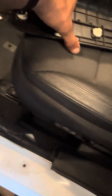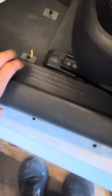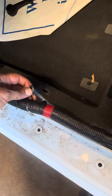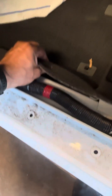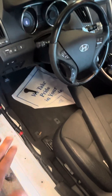To get to that, you take a tool like a plastic crevice tool and you pop this out. That will pop out and then you have to remove this zip tie to get the wiring harness up, and then you move the carpet and kind of air things out. You can actually grab that little stopper and slide it back. You don't have to do this — you could just open the stopper and that's it. Clean the water whatever way you want.